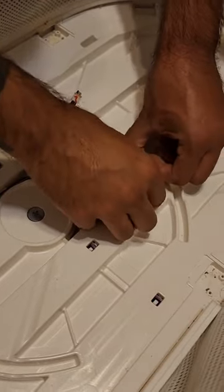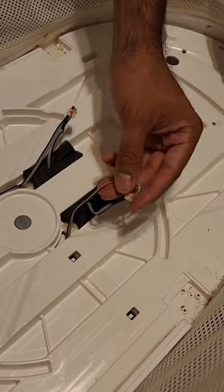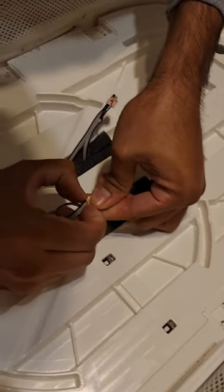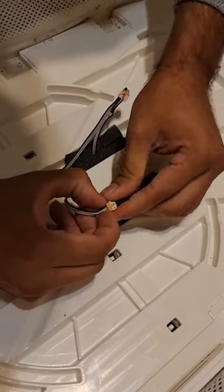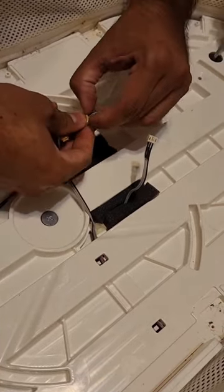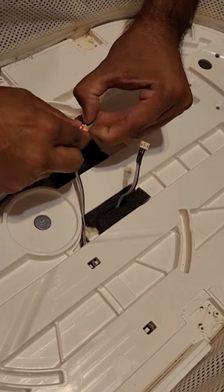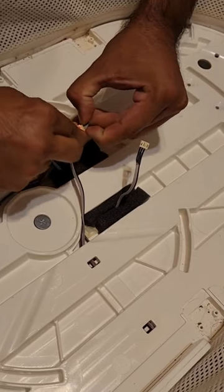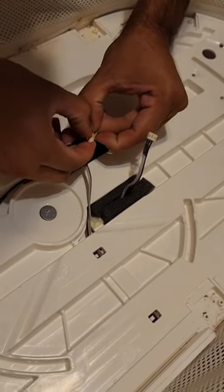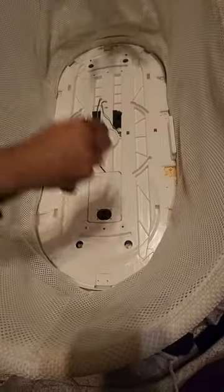As you can see here, it's a little hard but once you release it they'll go just like this. Do exactly the same thing to the other side, and once you've released them you're going to grab the tabs here and slowly remove the harness just like that. It takes a little bit of patience — don't pull from the cable, pull from the actual connector, because you don't want to damage the cables. Re-soldering these is a very tedious process.